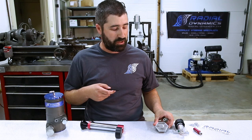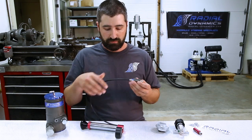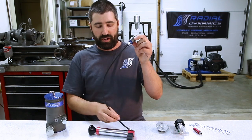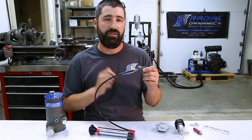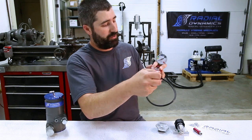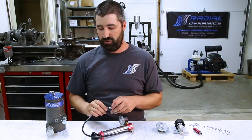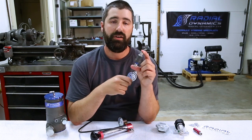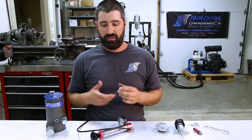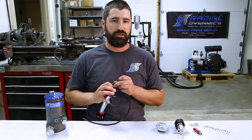Even though the 8 to 10 psi cap might be close to the same maximum under maximum airflow rates, this valve will actually hold significantly more. The blue port is open to atmosphere — you'd run an open-ended tube down to a safe location on your chassis, away from hot engine components or the exhaust. If I try to build any pressure from outside the reservoir, you can see it just allows air straight through. As the oil heats up and expands in your steering system, the valve vents some air out. Then once the oil cools back down and returns to its normal fill level, if air isn't allowed back in, your steering system might be under a vacuum the next time you start the car — potentially resulting in excessive cavitation and whining of the pump.